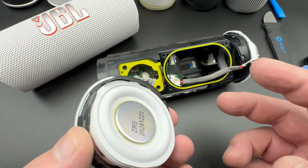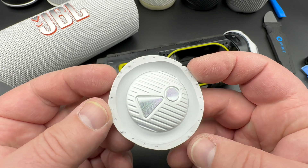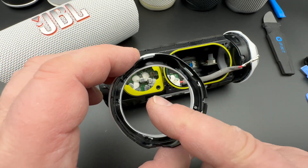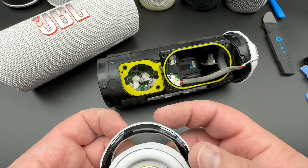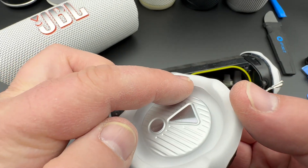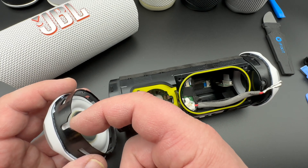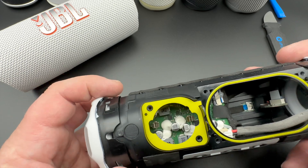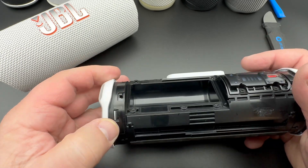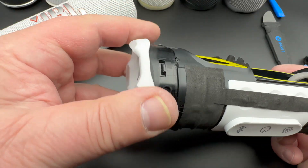This is one of those passive radiators. It's easily removable — it has those pins in here so when you put it together it fits right in there. It only fits one way; you have to make sure that it sits in correctly. When you plug it in, it has to be a 100% fit, no gap. This part here with the round edge aligns with this part — it only fits in one spot, one way. Clips on like this, and you need to make sure that all those clips engage. Put some pressure on from the top and now it's 100% open again.